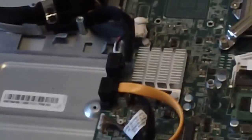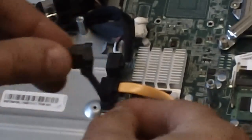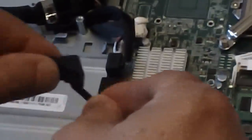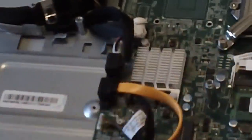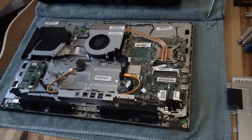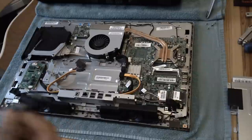The orange one isn't original - it should be this one. The problem is that when I bend it, it gives at a certain point. So the actual issue is the cable between the motherboard and the hard drive. That part number is in the description for the video.